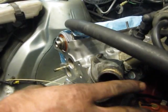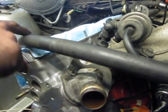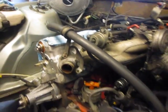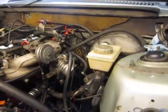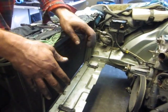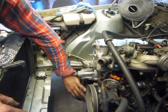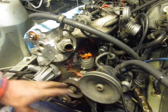When you put the housing on, remember that there's a bracket we took off — this is an engine lift bracket and also for the AC line you had another bracket. Remember to put those back. At that point we're going to have most of the fuel injection back in place. What's left is the air mass meter, the rest of the duct work going to the casing and housing for the air filter — we can get to that. Our next job after this is we're going to focus on putting the timing belt covers, tensioner, and timing belt back on so we can focus on getting the belts back on.